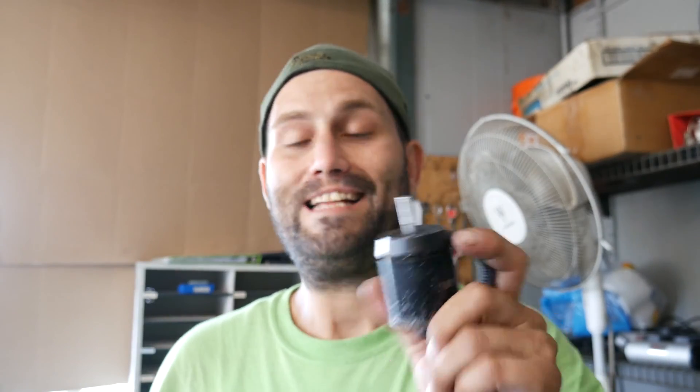You wanna get that gear off — it's not always easy to get off, especially if you have a stock Evolve motor. I can tell you, use a one and a half millimeter wrench and you're gonna have to heat it up. Once you heat up that gear, this motor is gonna be rendered useless, so don't take that gear off unless you're completely done with it. I used a propane torch, gave it a nice little heating. The set screw comes out real easy. Once heated, use a body panel puller or screwdriver and pop it off. There's a little bit of adhesive in there that melts and expands, so while it's warm, pop it off. Gear's off and we have just the motor.